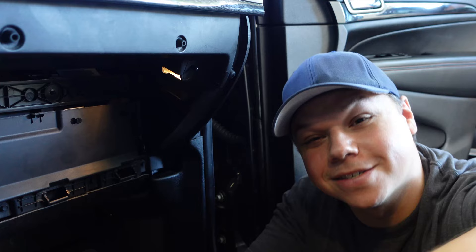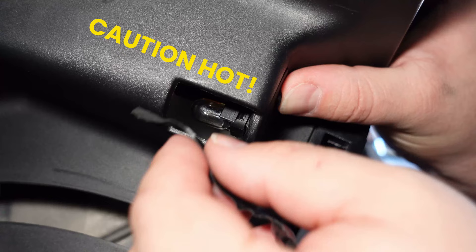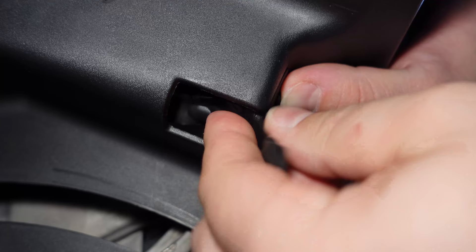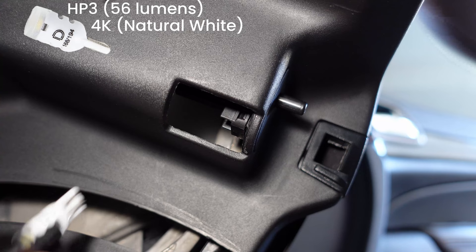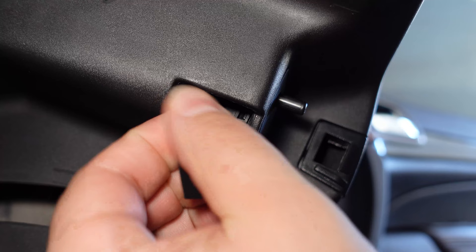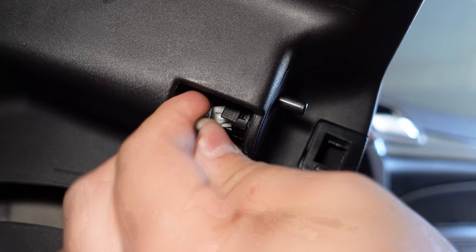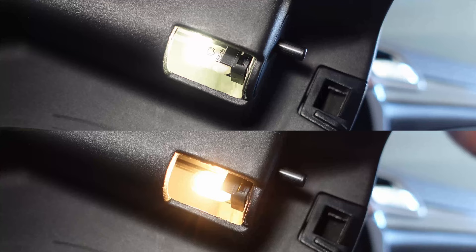I'm going to show you how to do this because I had to destroy my hands to do this. So you'll want to remove the glove box, unhook the tether, squeeze the sides, and it's out. Then just pull out the glove box shelf. Now, this bulb will be hot — depress the switch to shut it off. Grab some electrical or scotch tape and wrap it onto the bulb. Make sure the tape is on the bulb when you go to push it out so you don't drop it into the abyss. With the old bulb out, the easiest way I've found to put in the LED is to put tape on it exactly like I'm showing here. Then use the tail end of the tape to get the LED into the socket. Take your time with this — it will go into the socket, trust me. The first time I did this, I lost both bulbs into the back of the dash. I did manage to find them after taking almost everything out from under it. Eventually, after a lot of attempts and a lot of tape, I got this to work as it should.